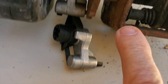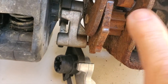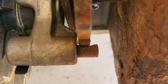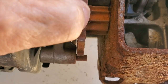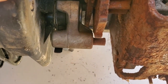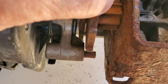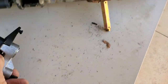This wheel is spinning because the shaft on here is worn out — it's got a little dip worn into it. If you look real close, you can see how that's worn down. That's why it doesn't catch when you step on it — this freewheels because there's no steel there. See that gap in there? There's no steel in there. I have fixed that before by welding — filling that in with weld — but this part right here you can get for 50 bucks, so it's not worth messing around with.